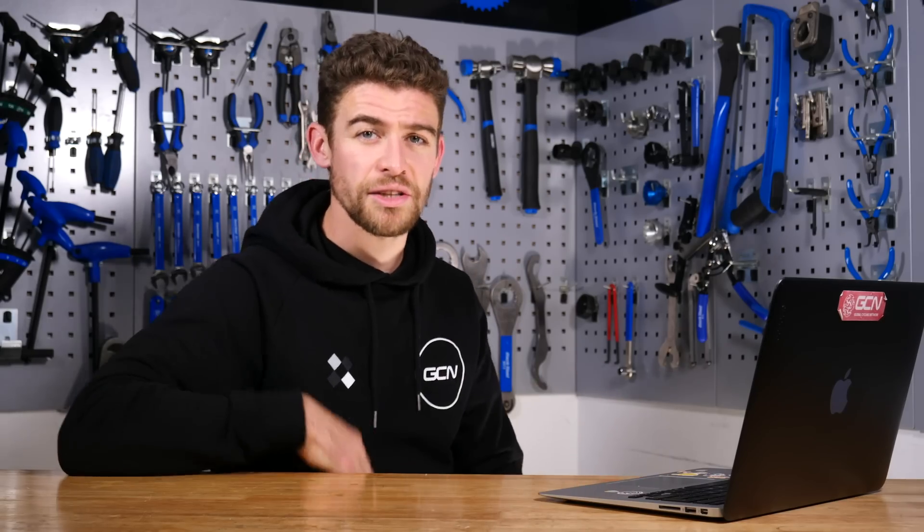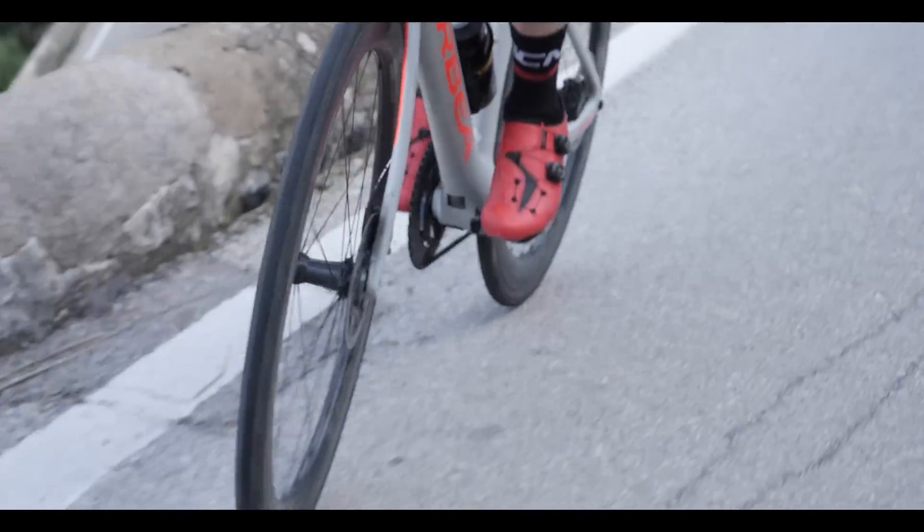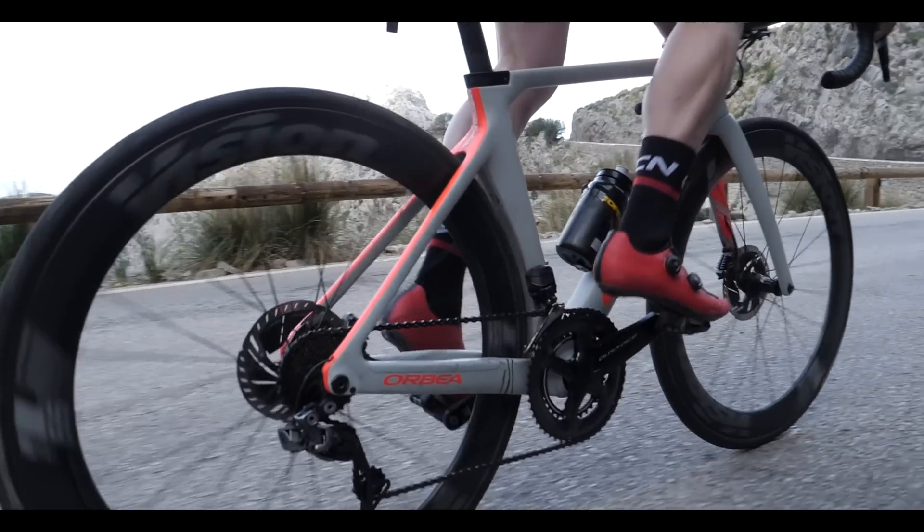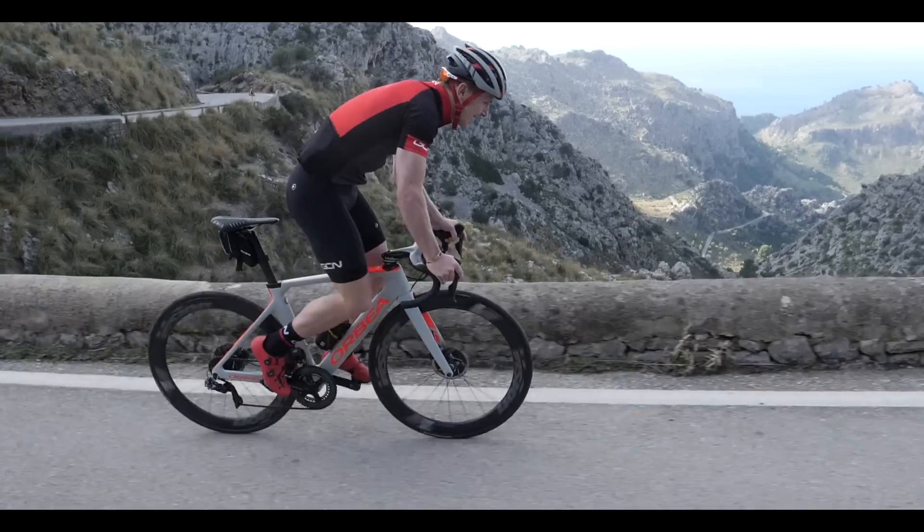The invention of 110 BCD came about because people were after smaller gearing. You can drop down to a 34 on a 110 BCD, possibly even smaller, and that gives you a wide range of gearing. You can still use a 52, 53, or 54 on the front, meaning it's probably the best way to change your gearing. Alternatively, you could use a larger cassette on the back. Going from a 25 or 28 up to a 30 or 32 will provide a little bit of extra gearing, although it won't be quite as big a change as going down to a 34 or 36 on the front.